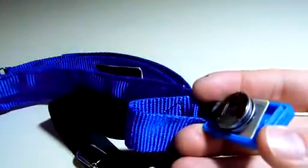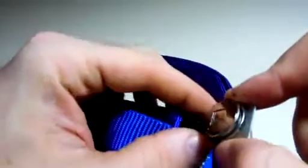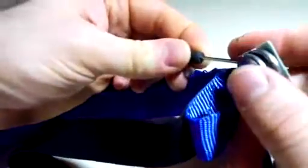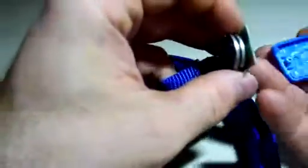The battery is actually inside of here. In order to get to it, you have to unscrew these three screws here on the bottom like I've already done. That'll open up the enclosure here. Then you've got your two button batteries — those look like they might be two CR2032s. But as you can see, it's really easy to get to. Then to put it back together, you want to make sure that the two screw holes are down at the bottom.